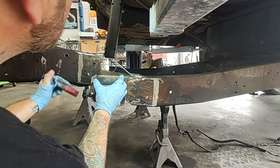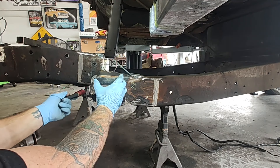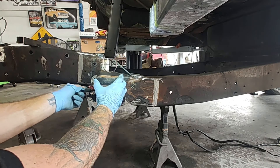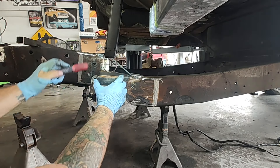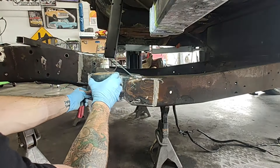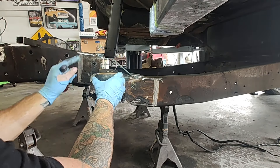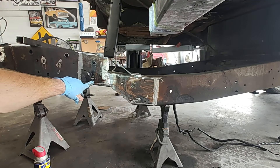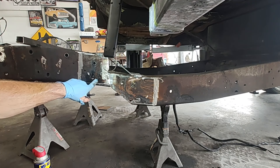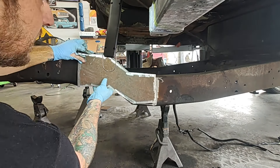You can see there's some overhang. We're just going to take a marker and run a straight line right here so it doesn't hang down and look weird. We'll mark it and then cut that off. Same thing over here, there's a little bit hanging over there. From there we're going to weld this thing in place — we don't have to worry about bolting it back in, it's going to be welded in place. We've got our alignment hole — we don't have to make it any bigger, that hole's good enough. That way we can come around through the back and poke that back through this front plate. Let's go ahead and get this put up in place and get that welded in.